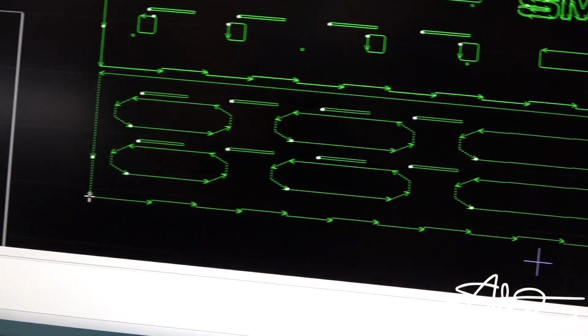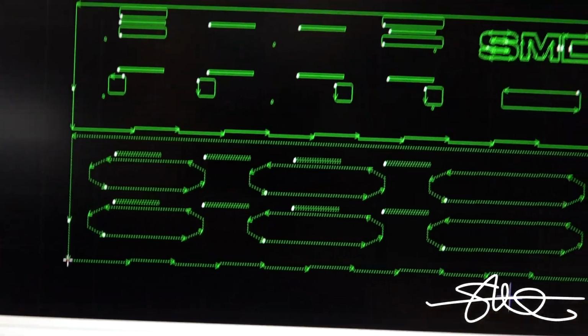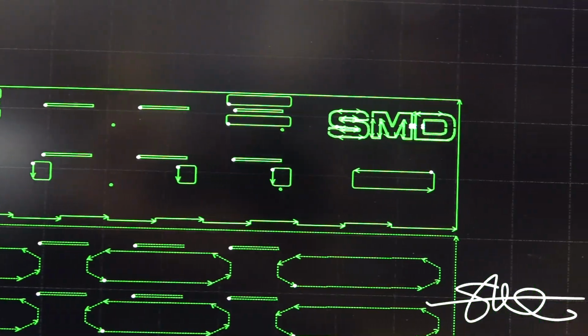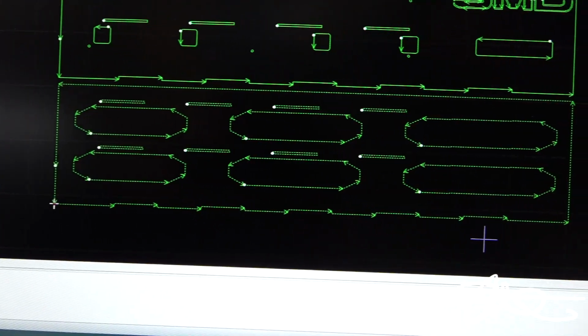So I was almost getting ready to end this video and move on to maybe some welding and some wiring, but after a long drive and thinking about the things that I want to do, I decided to add a couple things to it. I want to put a back plate on it so it's not just those little tabs coming through touching the box. I want to box it in, and eventually probably put a cap over the top with some HDPE or something, but I also wanted to add a couple of holes so the wires could pass through and reach to the amps without having to go up over the top or anything like that. So here we go. Cut the bottom piece, which is exactly the same shape as the top piece. And once that is out, I can put that top piece that I already cut back in, put my logo in it, put some pass-through holes in it, and it should line up exactly where it's supposed to be.